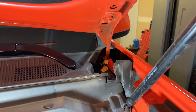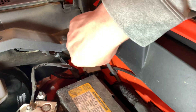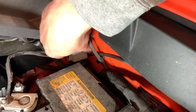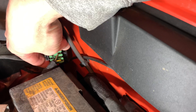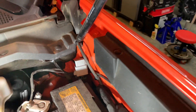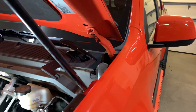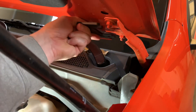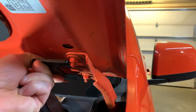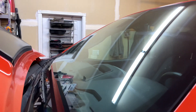Now let's talk about wiring. We have the Dusk Edition truck that came with the off-road lights on the sports bar. Thanks to the channel Horsepower Obsessed, they already showed us which wire to tap into. This is the relay for the sports bar lights and we'll be tapping into the yellow wire here. I just don't want any additional random light switches up in the cabin. Here are the brackets and this is right where they mount. I really like this setup — they don't stick way up over the hood like some other kits do, just enough to give a nice rugged off-road look.